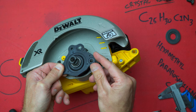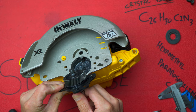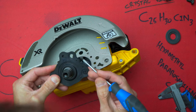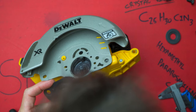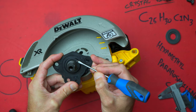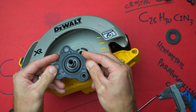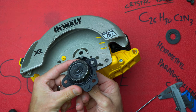It is taking up a fair amount of the cutting load — as the blade wants to kind of twist, this plastic piece is taking up a lot of that load. The bearing is also a sealed bearing, nothing spectacular — China HYA inside there — 6001RS. For the size of that bearing, the other is just a standard piece of turned steel, nothing too spectacular.